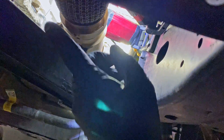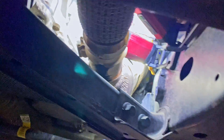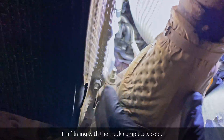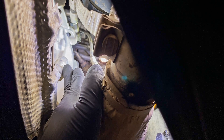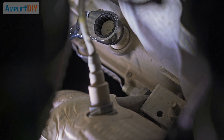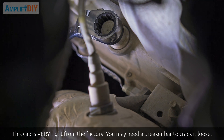I'll crawl under the passenger side of the truck. Immediately you can see, just on the inside of the frame rail, there's a cross member, and directly above that is a flex pipe from the exhaust. If you follow that flex pipe forward, you'll come to the catalytic converter. Be very careful not to touch this when the engine is hot — it will burn you severely. Right next to the catalytic converter is the side of the transmission pan, and if you reach up in that crack right between the catalytic converter and the transmission pan, you'll find the fill plug on the transmission that we need to remove. Having a flex head wrench is really helpful here as it's a very tight area.